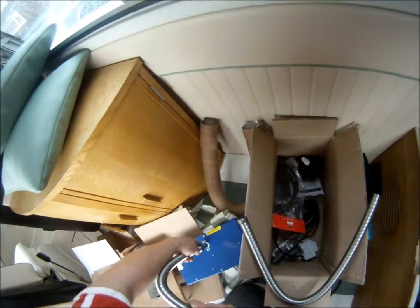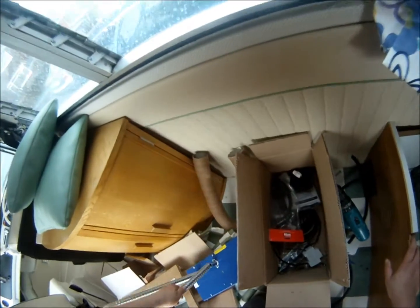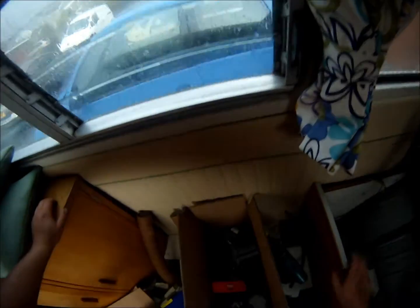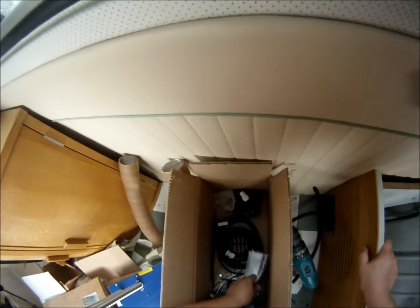I've got these metal pipes. One of them will go on each pipe. If I remember rightly, one is tight and one isn't. Yeah, that's the one that's not. The painted one is the inlet and the non-painted one is the exhaust. The inlet has got to be in front of the exhaust because when you're driving, the air doesn't want to be sucking in the exhaust air that's just come out. So I'll poke out the floor then, and when it's a dry day, I'll route them.